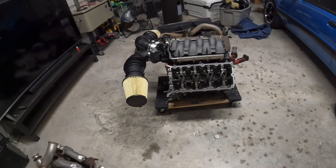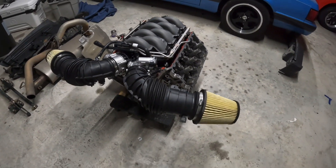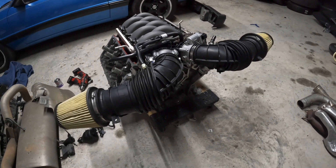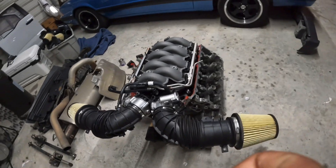I do have data on our 18-to-23 GT intake with the ram air. That combo was good for 8.80s in zero DA and 9.30s in 1,500 DA. The reason I haven't tested this intake yet is because a heat wave came through Texas — it was literally 89 degrees in early February. But tomorrow a cold front is coming through, dropping to 65 degrees, then 55 the day after, which is roughly 1,500 DA and zero DA respectively — the same conditions we ran the GT intake in.